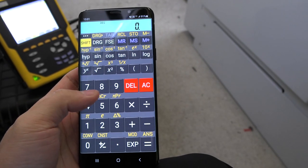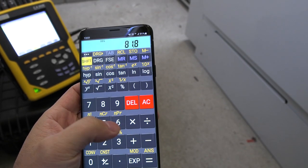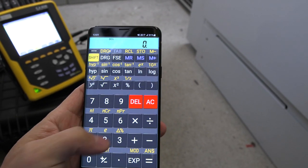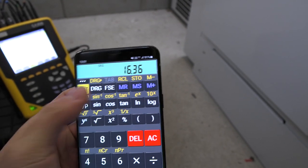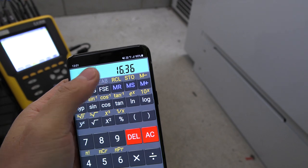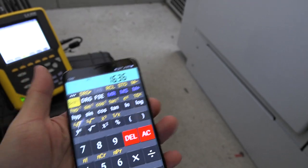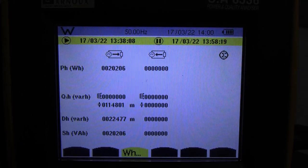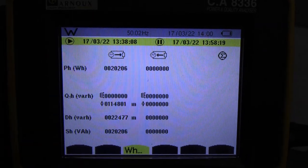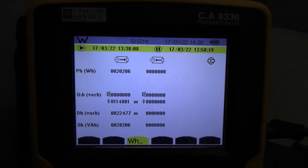Based on the discharge rate, I know that when you discharge the car you have a certain kilowatt hours in the full battery. Since we have 20% of that, you see 16 kilowatt hours — though you have to account for some discharge losses. So 16 kilowatt hours is what we can expect went into the battery. From the grid, it delivered 20.2 kilowatt hours — very accurately measured by the electrician. We can now calculate the efficiency, and then we do the cable test.